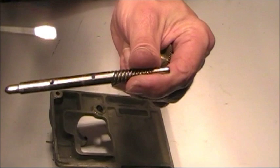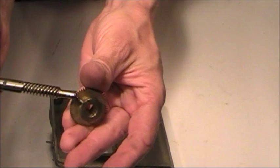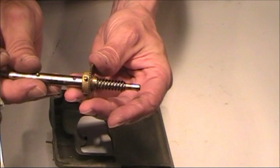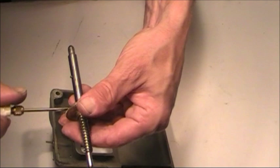On the spindle you'll notice that there is a small indention right here, and this keeper screw is going to want to line up with that hole. So what I do once I get it into place — it goes on this way — is I put it close to where it needs to be, knowing it's not in that hole yet, and I'll go ahead and tighten the screw just to where it's touching.